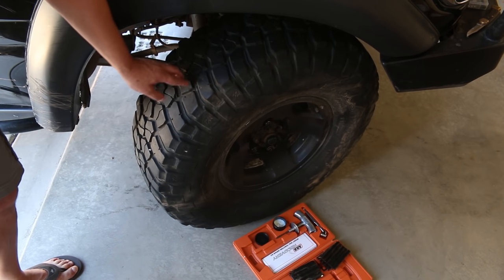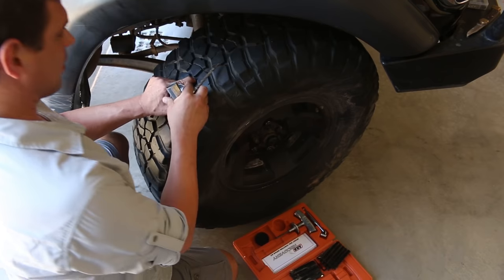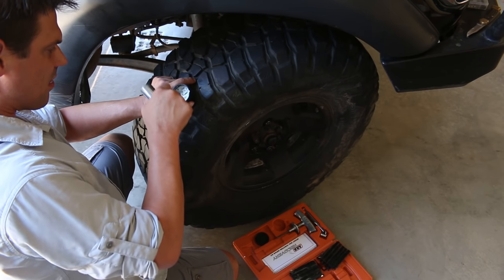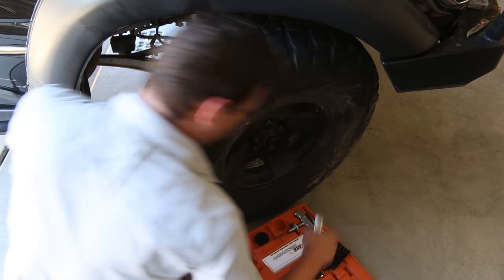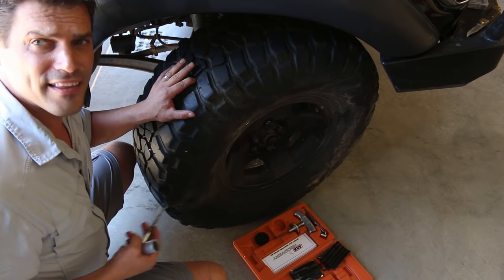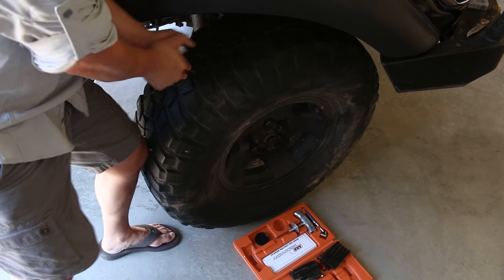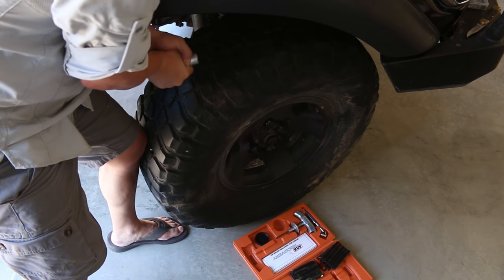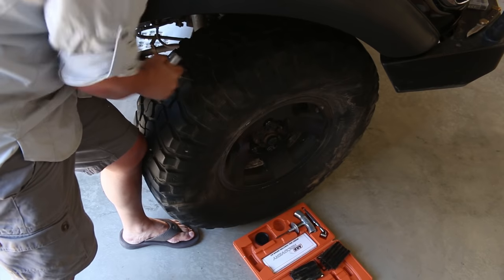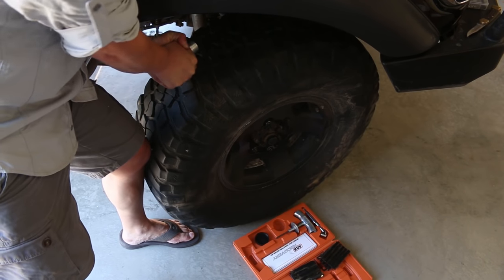There's the hole. Once you locate the hole, take the reamer — the spiky one without a hole in the end — and put some grease on it to make it easier to bore out the hole. If the hole is too small, when you try to put the repair rope in it's going to be super hard. You want to bore this out. This tool spreads out the belts in the tire to allow you to get that repair rope in. Work it in and out a few times — the reamer is the right size for the repair rope — you need the hole stretched out a little bit.